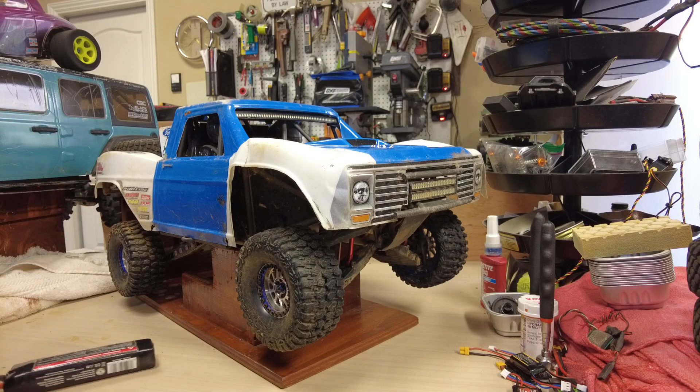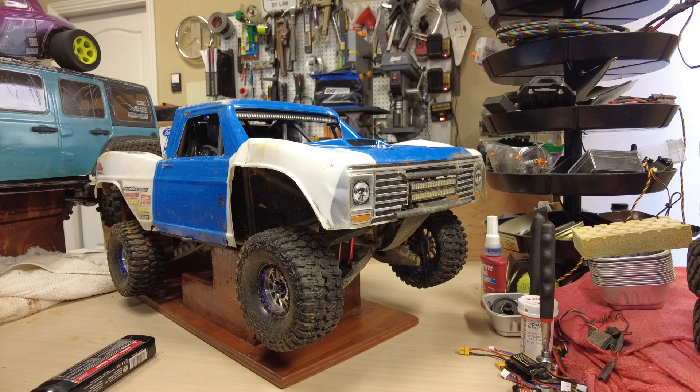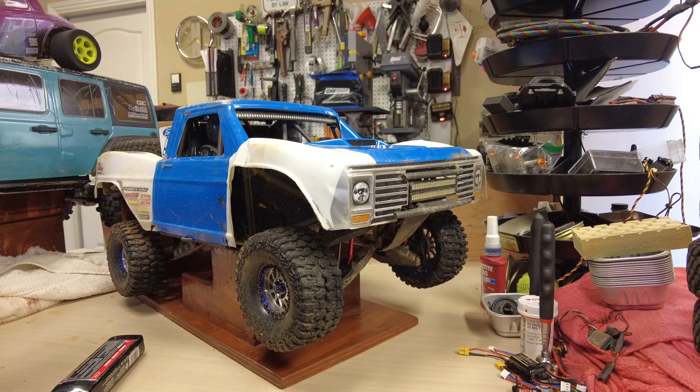It is Traxxas selling them with these connectors, but it's kind of the nature of the beast. The nice thing about EC5s and similar connectors — like the old Castle connectors — they're cylinders, they tend to lock in a lot better, keep out dirt, and you get a better contact throughout the whole thing. The electronics in this truck have run really well overall.